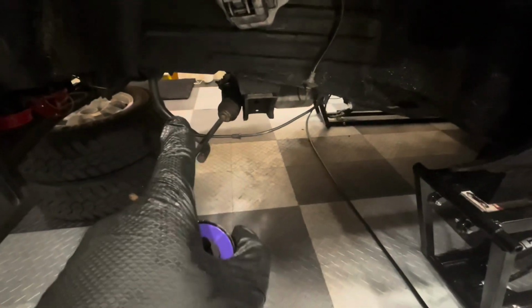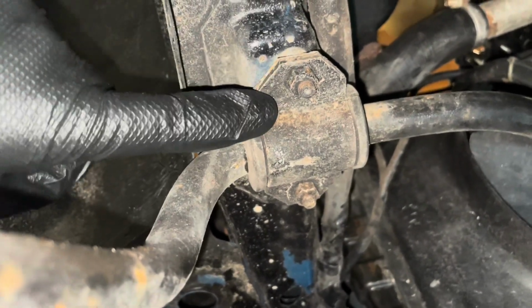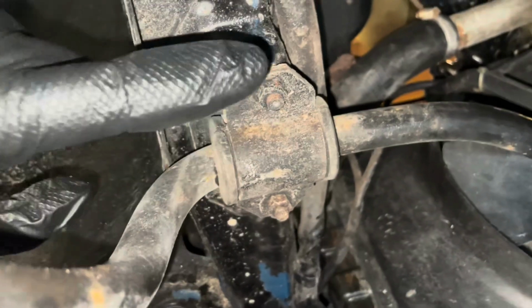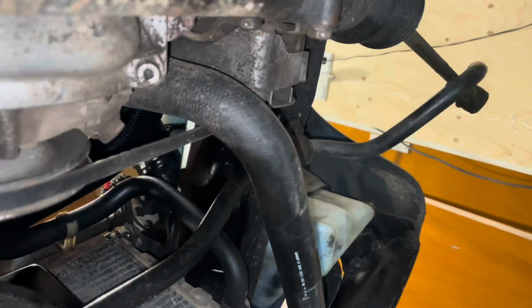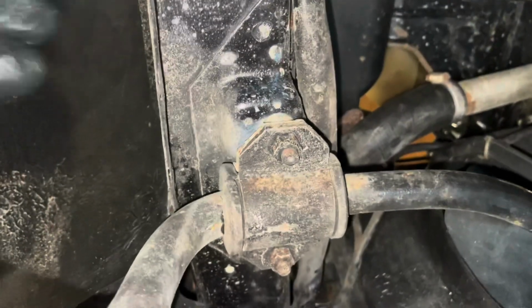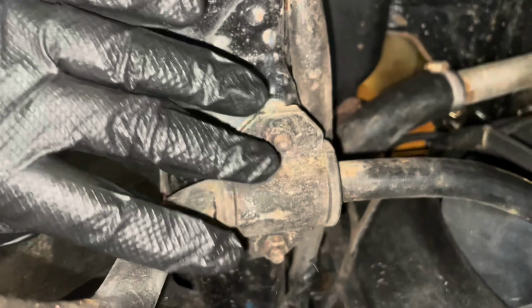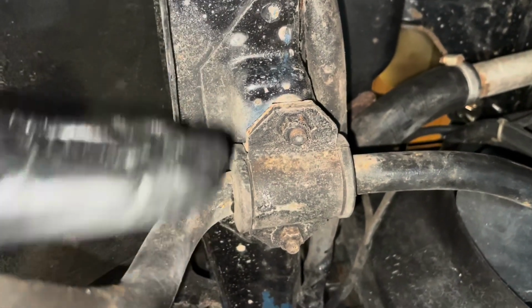So in that case, we are going to go down here quick, get the steering rack out, get the anti-roll bar out, and get this cross member out. We're under the car again. The anti-roll bar is still hanging on with two brackets, this one, and same on that side. You can see it right there. These are 13mm nuts, so I'm just going to quickly take this apart, drop it out, and then we can clean the anti-roll bar and give it a coat of paint.